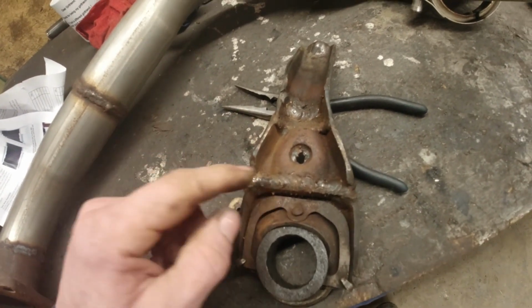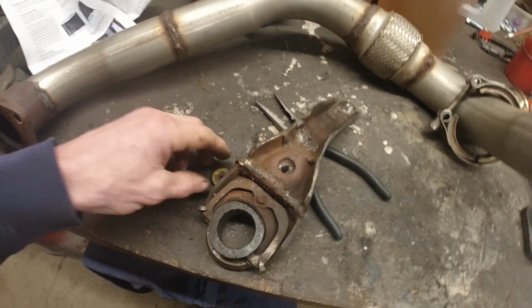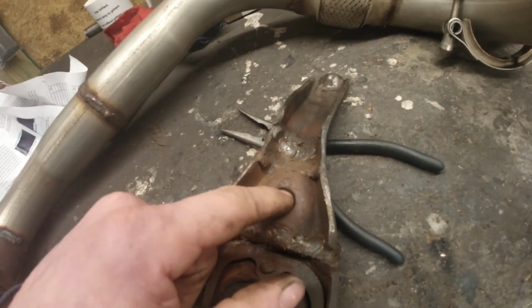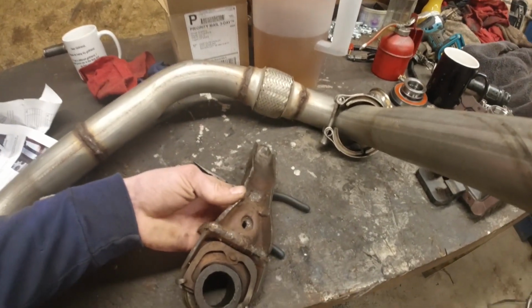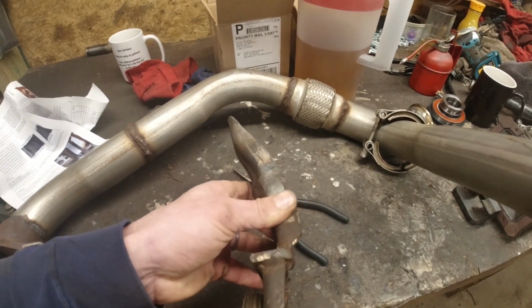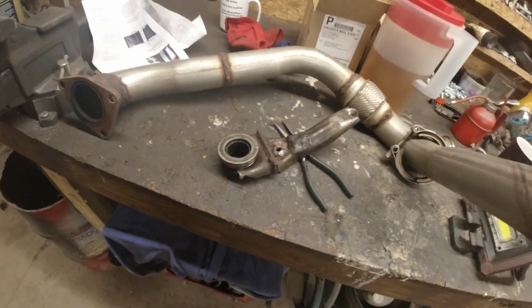So I'm going to go ahead and get a different fork in here, so I don't have to worry about that, because it's got quite a squeak to it. I didn't grease this or anything, but I'm pretty sure it's coming right from there. This thing's walking on that pivot a little bit when the clutch is disengaged, so it's just sitting rattling just enough to catch a squeak out of there. So that's annoying. Gonna get that taken care of.